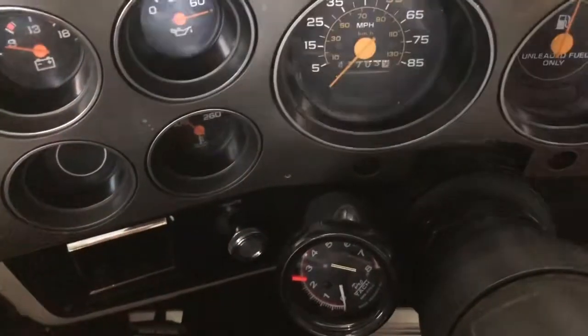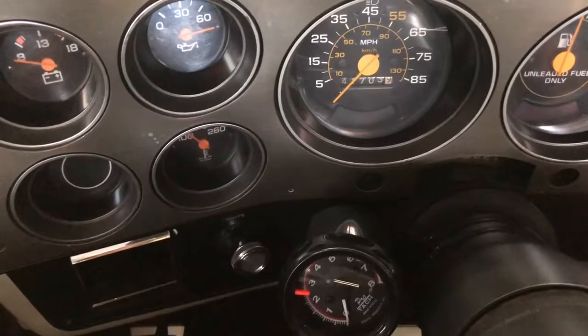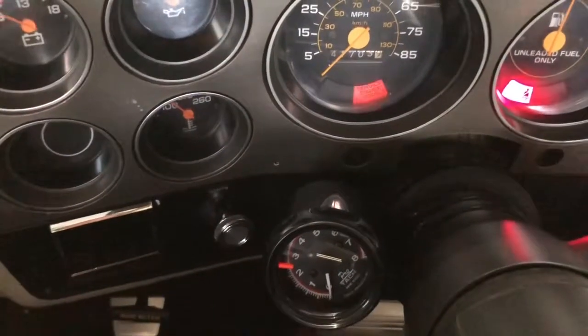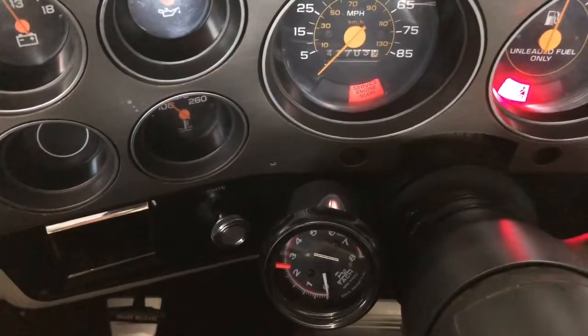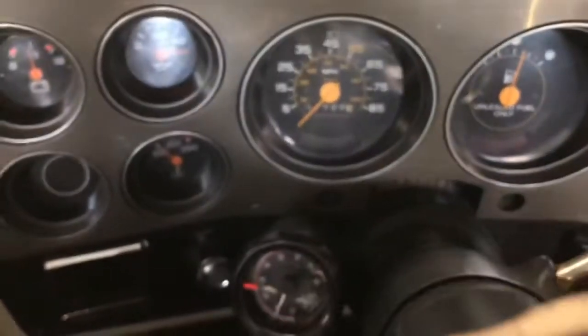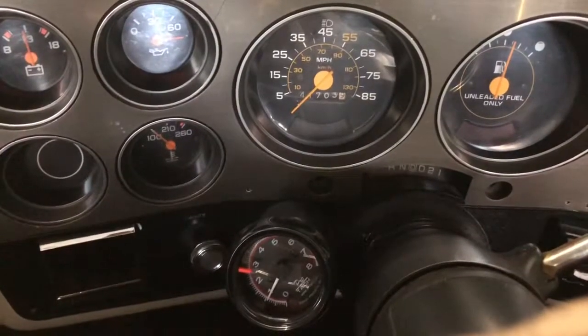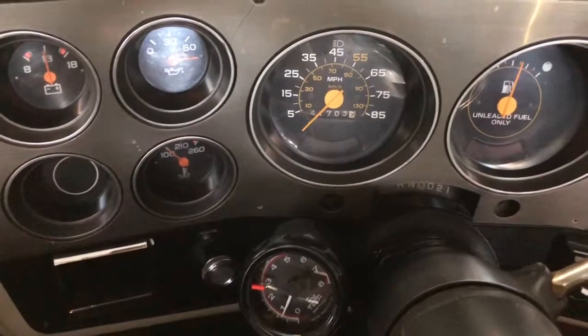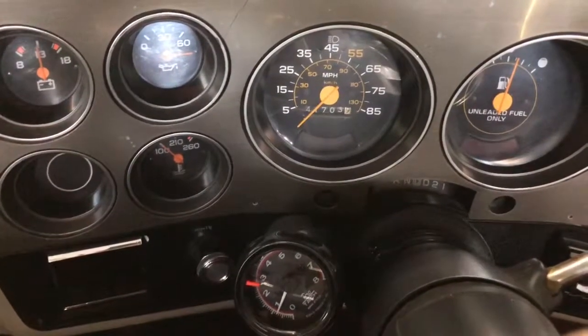No, the tach is kind of hard to see. We're gonna do a startup just after we installed the negative side of the battery after replacing the IAC valve. Got it back to idle, looking at about 900 and dropping. There we go. Now it's settling in.